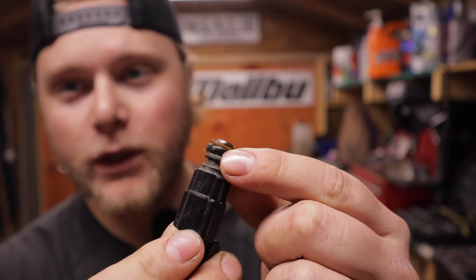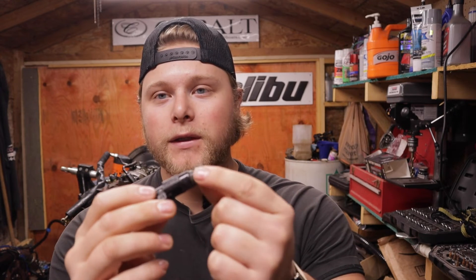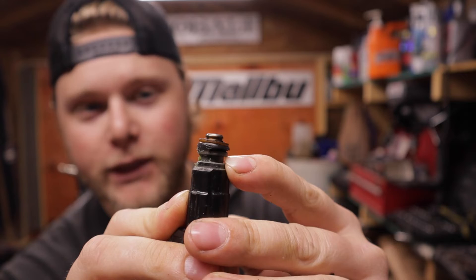From installation, if this thing got pushed up on something that little piece of missing o-ring could cause an external leak. But more likely, since it's on the spraying side not the feed side, it could have been causing it to leak a little bit of air, and that little bit of air would cause it to think it's running lean — which would make the computer add a bunch of fuel to that bank giving us our rich code. Here's another one on the same bank — also on the spray side it's got a flat spot like it was put in on an angle and tightened down. So watch out for busted o-rings on that bottom side.